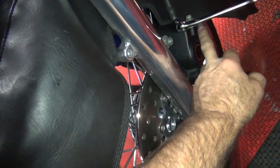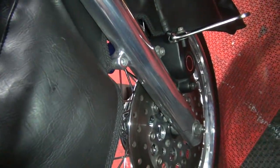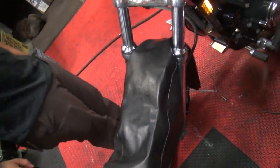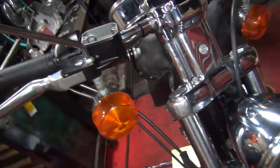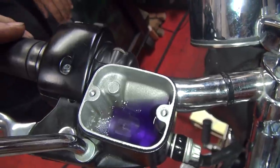So that's the caliper made — it's a floater. Where's the bleeder screw? We're going to have trapped air from here up, so that will never bleed out. So you have to put pressure on a brake, but until you get pressure down here, there's no use to open that valve. So once it gets pressure, then you can go ahead and pop the valve off and it'll go through. Now some people like letting the fluid just drain all the way down and they think that's going to bleed it, but in the real world, the fluid goes right by the air bubble and keeps on going. You've still got air on that when you're done.